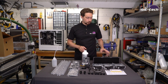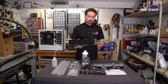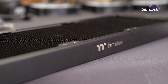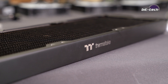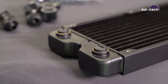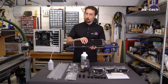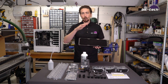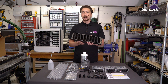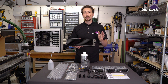Taking a look at the individual components, what we've got here is a thin 360mm copper radiator. Personally, 360 is probably the best starting point for a kit in my opinion. You can obviously find 240mm ones, but below 360 you're very much in the same sort of cooling potential as all-in-one coolers, so I would suggest if you're able to try fitting in a 360 or even bigger, or maybe a 360 plus another one. One of the handy things about the kits is that you can use more than one radiator, which you can't do with an all-in-one. So if your case is capable of fitting more than one radiator I definitely suggest it, but just remember you need to buy the extra fittings as well.